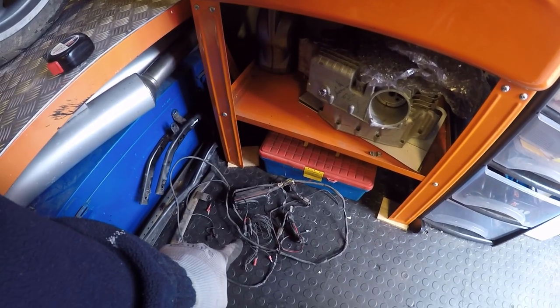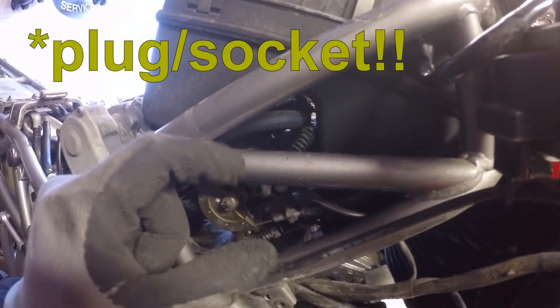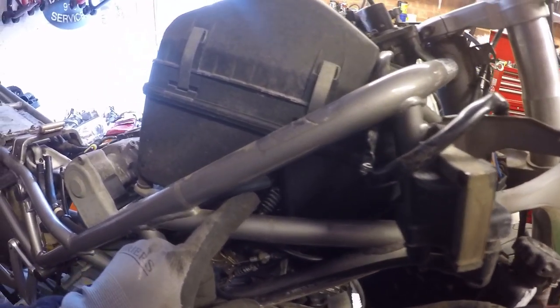One really bad wiring loom removed. Let's remove the battery box. It's a direct connection to the injectors on here, so unlike the 748s where there's a manifold for the actual electrical connections, it's gone direct to the injectors. So I'm going to quickly take off the air box so I can get clean access to take those off without damaging those connectors at all.